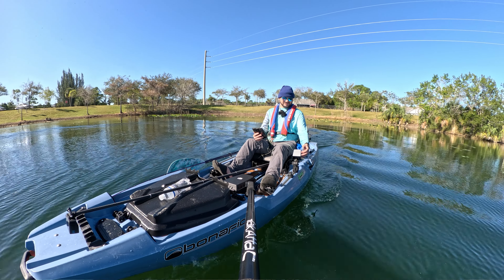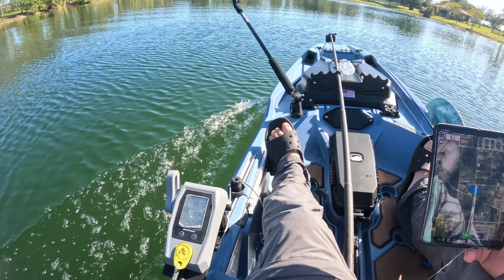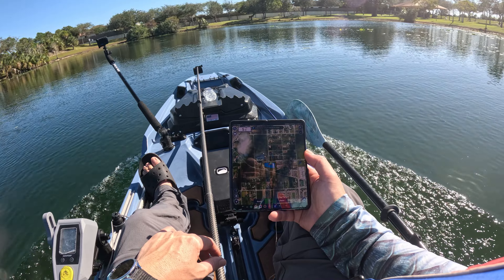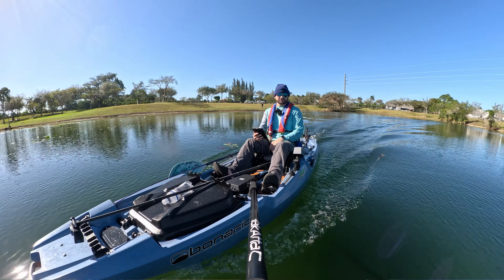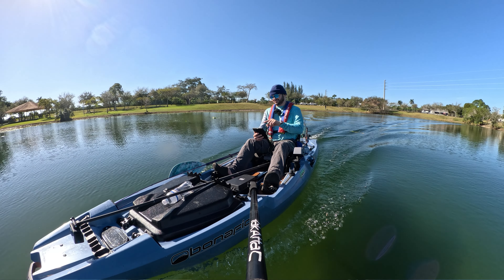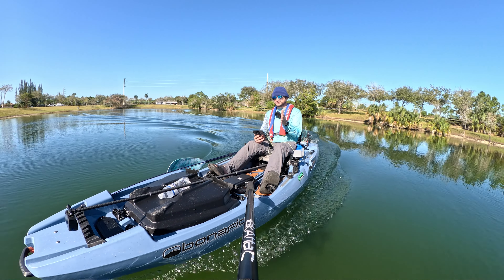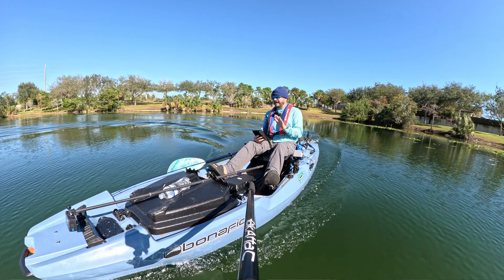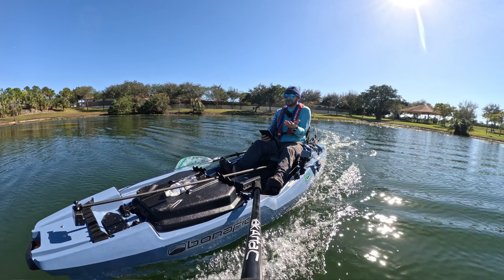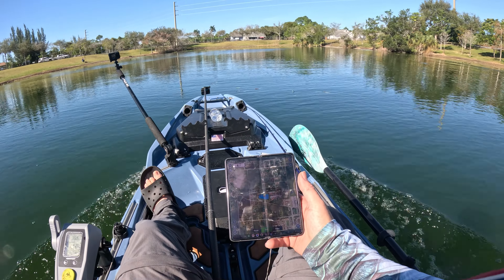Let's go to 50% power. You saw how easy it was to turn this engine — no problem at all. At 50% power, that's about 463 watts. You can do your own calculation for 25% — it'll be about half of that, around 230 watts. At 50% power we're hitting five miles an hour — 5.2. So at 50% power you hit about five miles an hour. I know at maximum 100% power it's gonna last about two hours and 20 minutes. If you go at 50%, it's gonna be over four hours — four hours times five miles an hour is 20 miles. Even now at lower power we're seeing 4.5, 4.9, 5.4.